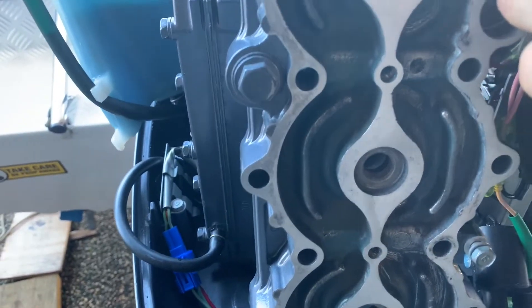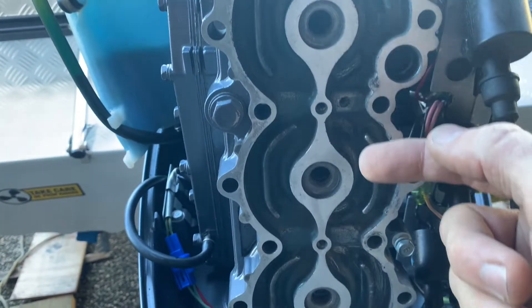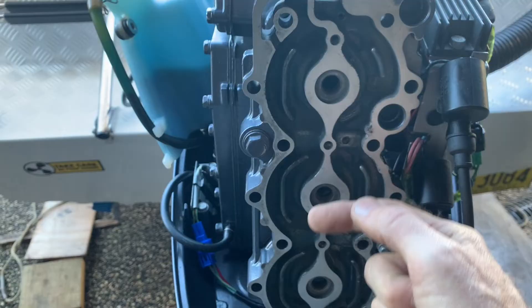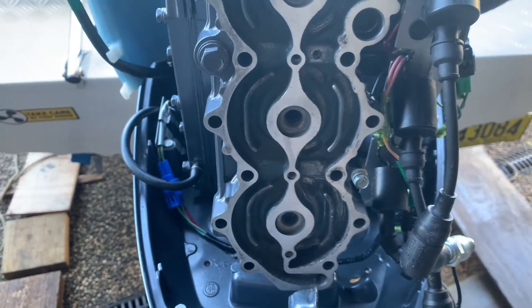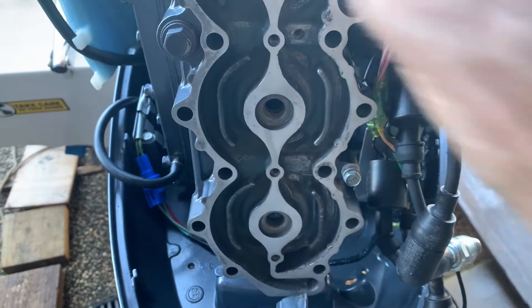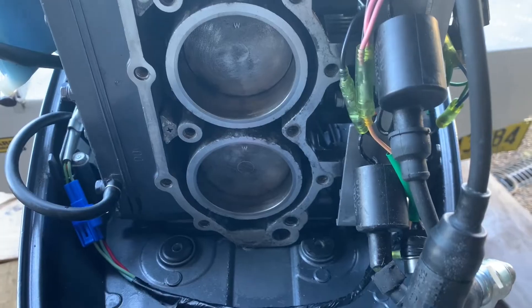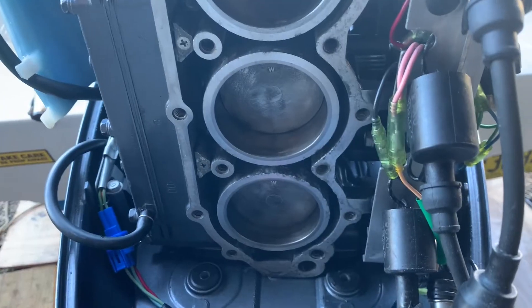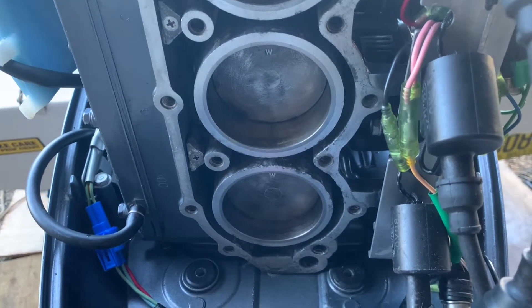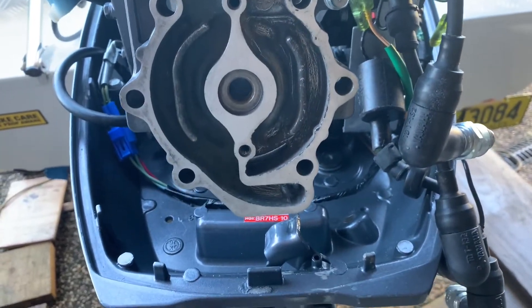You can see why the outlet ports are very clean, and the cylinder ports and head ports were very dirty - because they were holding water when the engine stopped. On this side it's just flowing straight out the bottom of the motor, not staying in there at all. This side holds water in the cylinders for periods of time, which is why you've got to flush them four or five minutes - you've got to let the engine heat up to operating temperature so the water cycles through the thermostat. You can't just flush your motor for one minute and think it's flushed. You've got to get the salt water right out, let it cycle through the thermostat, and clean the entire engine once it's flowing through.